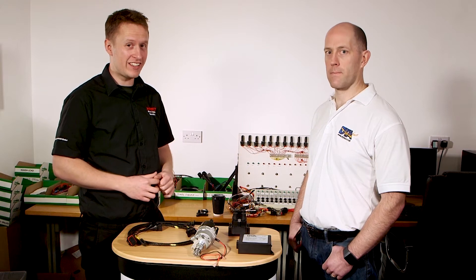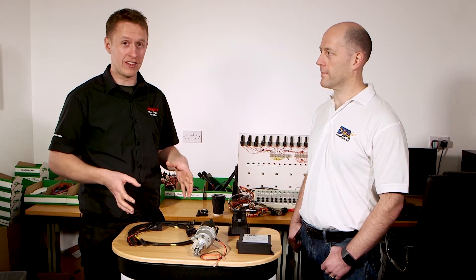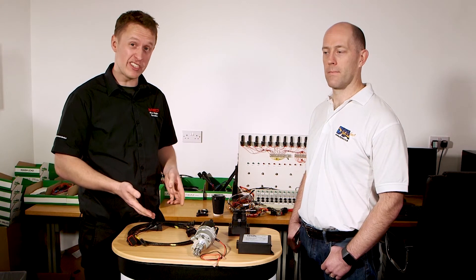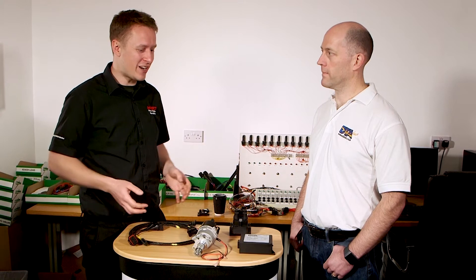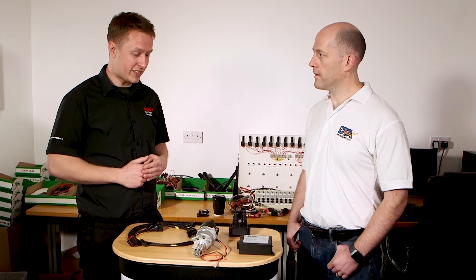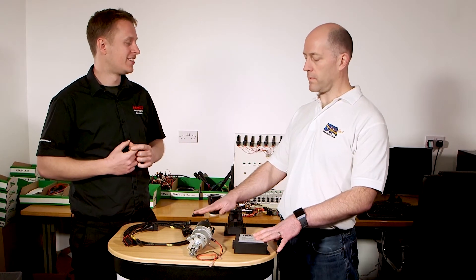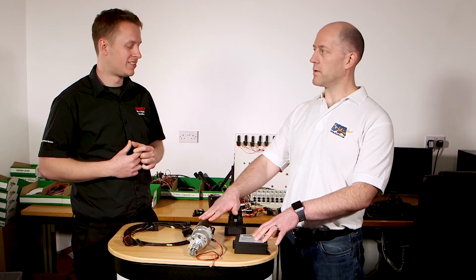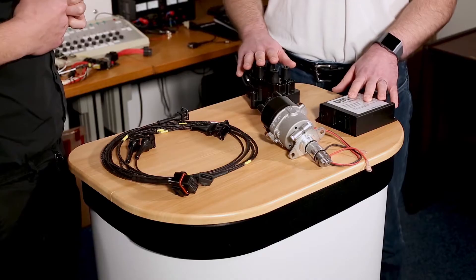Here at DTA with Alex, one of the things for the DTA kit that we supply at MED is that you can keep your distributor — something not many people know about. So Alex, how do you upgrade to a DTA and also keep the distributor? Well, your kit normally comes with a coil pack, which is what the wiring looms are designed for, so in that case you'd lose the distributor, fit the coil pack onto the bulkhead, wire it all up, and off you go.